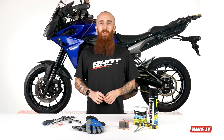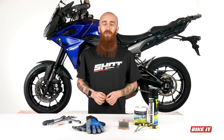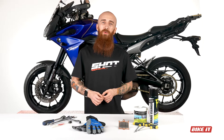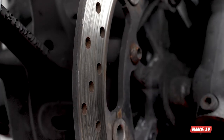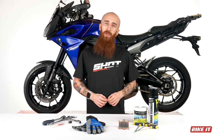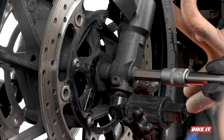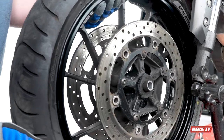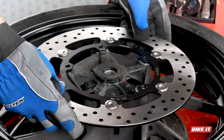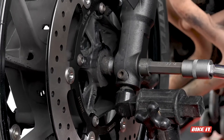At this stage it's always a good idea to take the opportunity to inspect the disc. Give it a spray and clean with brake disc cleaner — it'll remove surface contaminants as well as free off any stubborn brake dust. Once sprayed down, wipe over and dry with a clean microfiber towel. If using floating discs, it's well worth checking that the bobbins are free of grit and not seized too. As you can see, our disc is in a bad way — heavily corroded with an uneven surface — which means it's time to replace them. So we'll quickly remove the front wheel and replace the pair. We've chosen these awesome floating brake discs from MTX. And that's it, brake discs done.